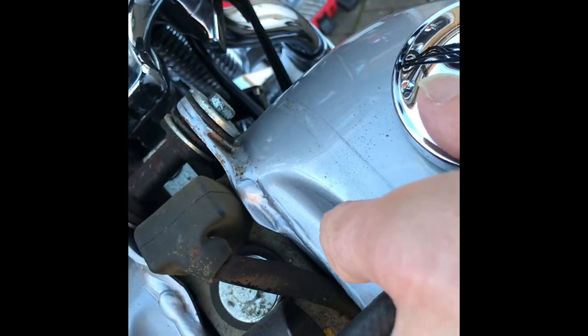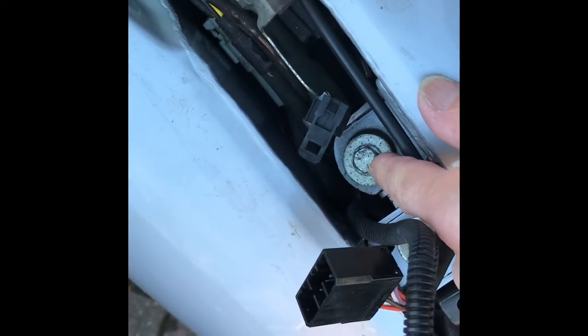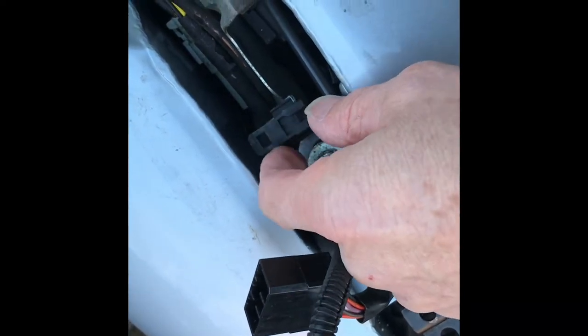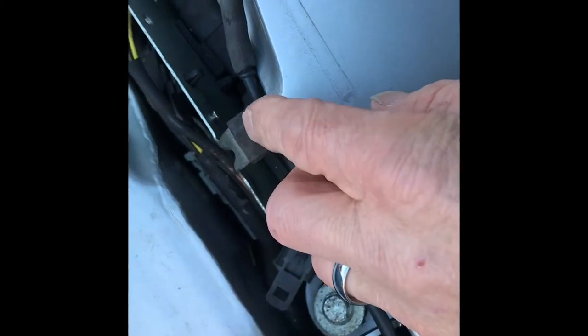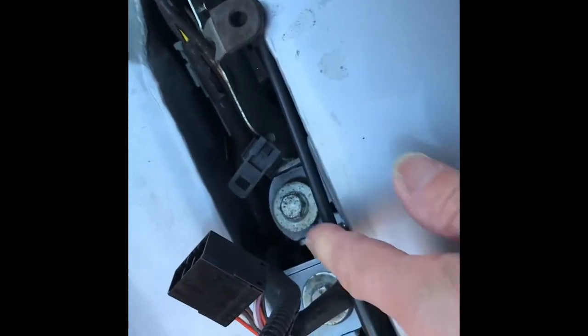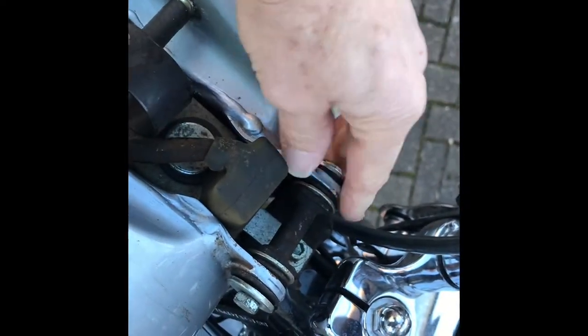Back to the here and now. So obviously there's a swivel bolt across there for the front mounting, and the back mounting is a single bolt. That looks like a locating thing, so that should go that way and slide in there when we put it back together. Let's get those loosened off and hopefully we'll be able to just raise the left hand side enough to get to the cables. I've removed the front bottom mounting bolt, slid the tank — there's a grommet in the fixing which slides over and then a bolt and washer holding that on.